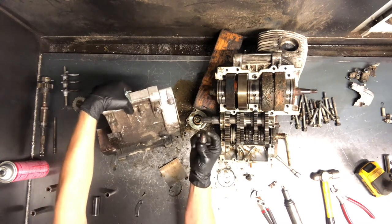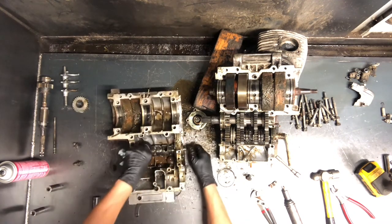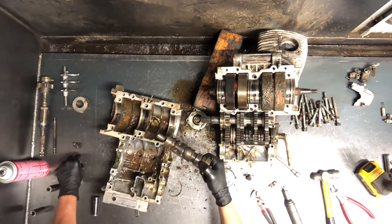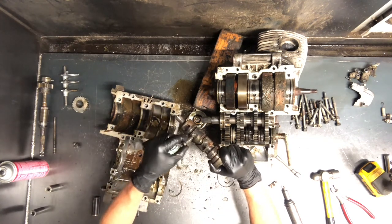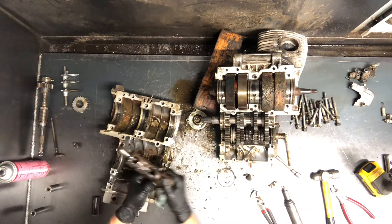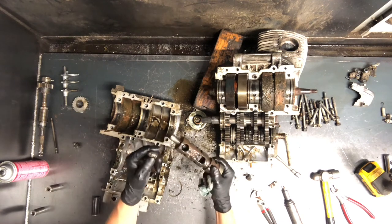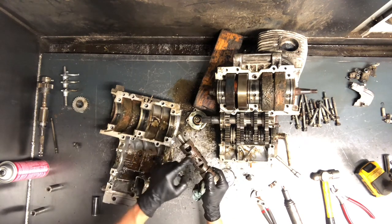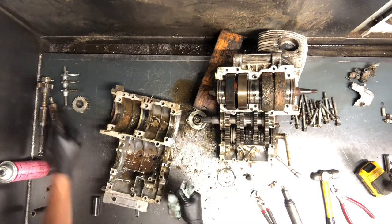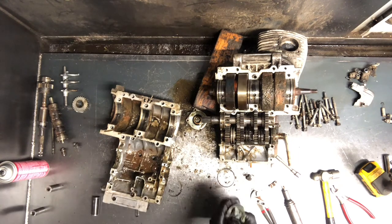What I said was your drain bolt is actually a spring-loaded detent that holds that drum into place when you're in gear. This detent slides into these grooves there, keeping you in gear. So if your bike is slipping in and out of gear, check this shift drum and check this detent here — make sure that it is spring loaded, make sure that spring is going up and down, make sure these aren't too grooved. Over time there's a lot that happens there.